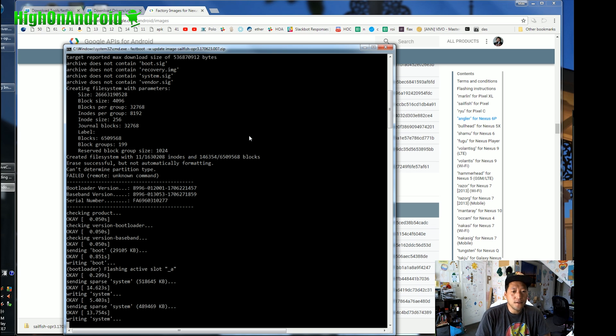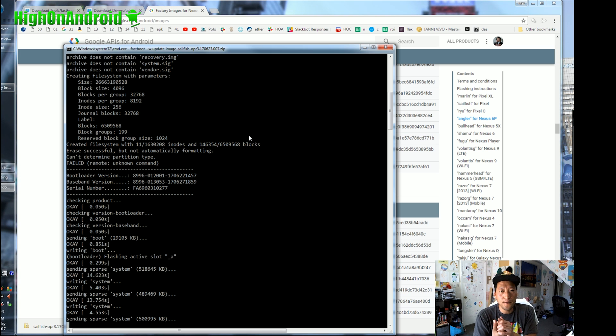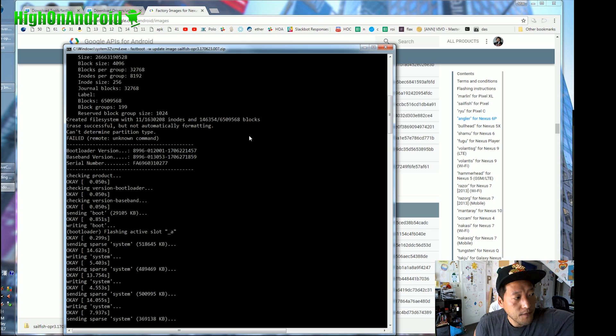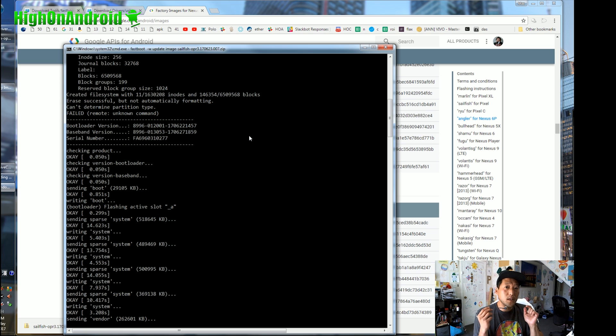For those of you who are rooted, you'll also have to flash back to Nougat first, then re-flash TWRP, and you can go ahead and flash whatever ROM file. If you're coming from a rooted phone with a custom ROM, save the TWRP directory and make a backup of your ROM. Copy it to your hard disk, or use a USB OTG cable and put it on a flash drive. Back it up there, and then later when you go back to Nougat you can restore from TWRP very easily. I do recommend getting one of these OTG cables — this one is for USB Type-B, but get one for USB Type-C.